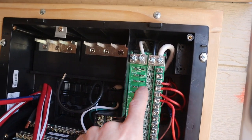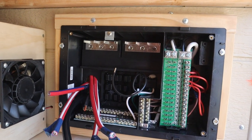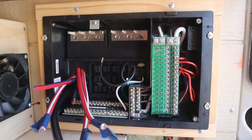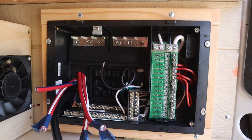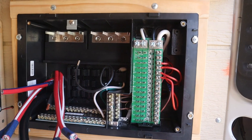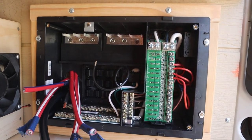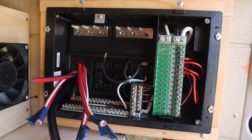Slots F3 through F15 can only handle 20 amps. So if you've got power-hungry stuff like slide-outs on an RV, you're going to want to use F1 or F2 because you can use a 30 amp fuse in those spots. All the other ones are 20 amp max. I hope this video is helpful — if you like this kind of content please hit the like button and subscribe. I'm going to be doing a lot more DIY stuff in the future, not only for this van project but I'm also looking for off-grid property.